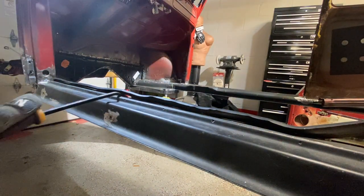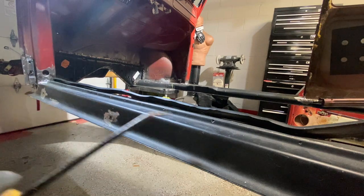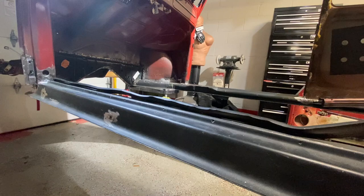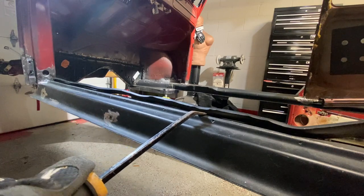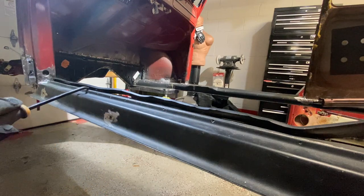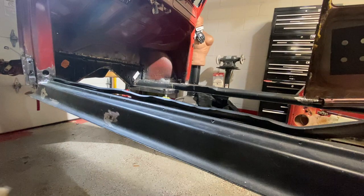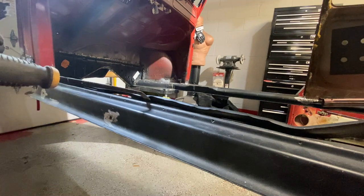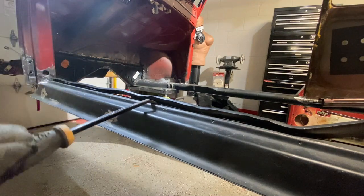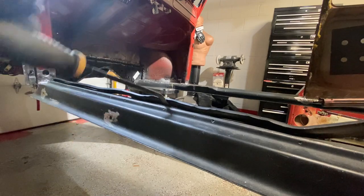You can see here there's a little bit of light. This whole strip here is held down by some spot welds — there's one here, another one here, another one here, a couple here. You could remove the spot welds, but you risk drilling a hole into the heater channel. That's why I don't take out the spot welds like I normally do. Usually I pry this up, and sometimes the spot welds are not in there very well and it just pops right out. In this case, it's not popping out.